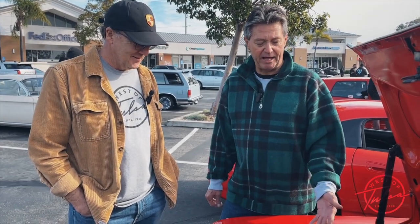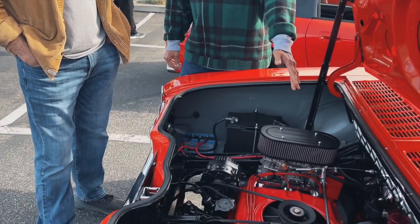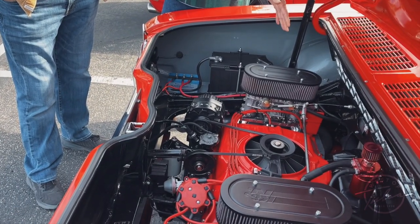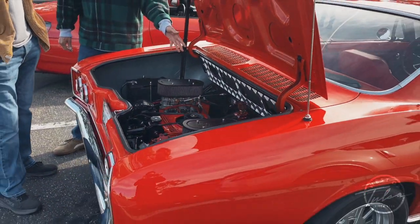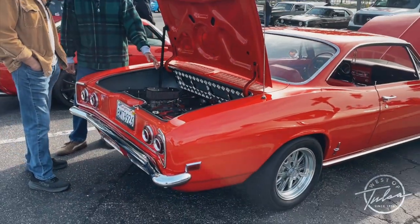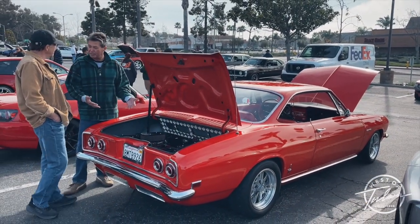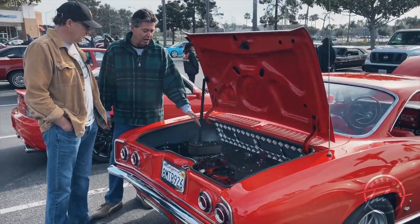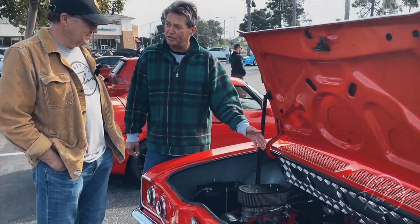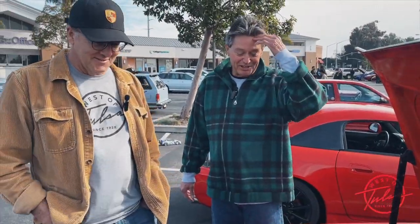To assist in that, these cars were always undergeared. This had from the factory a 3.55 gear ratio, and they did make cars with 3.27s — those normally had the automatics. That meant I was turning high RPMs on the freeway doing modern speeds. So I now have a 3.08 gear ratio in it, which means I'm doing 2,100 RPM doing 70 miles an hour on the freeway — makes it cruise a little bit better.